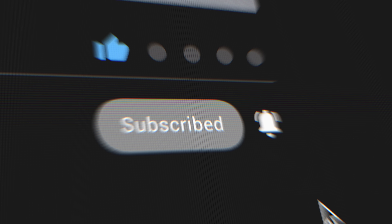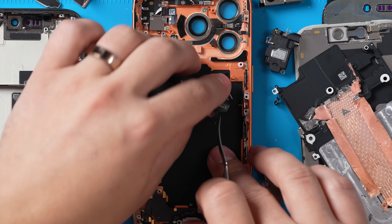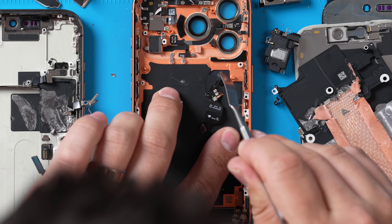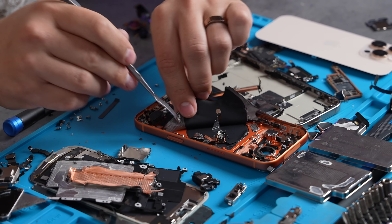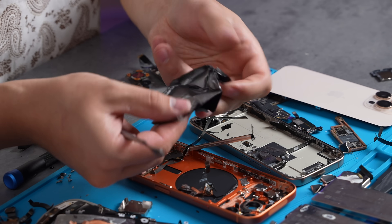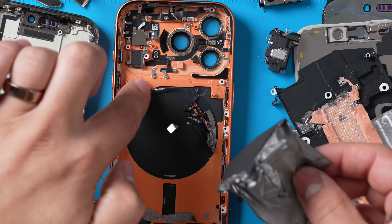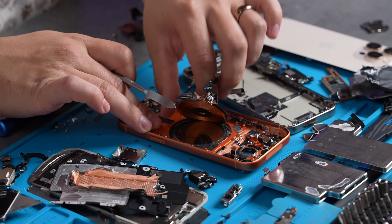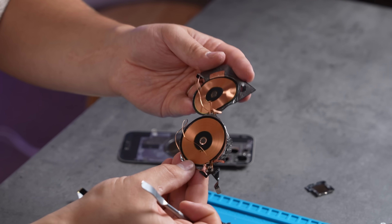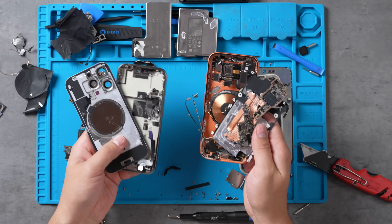Finally, let's look at the new magnet array with the faster MagSafe. I can pull this back and take a look — that is glass right there. There's a little graphite sheet underneath — very interesting how it comes apart. It essentially transfers heat from the copper coils all the way across the metal back. Looking at the MagSafe coil itself, it's pretty much identical to before, even the connectors, and the magnets are essentially the same as well.